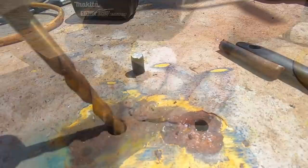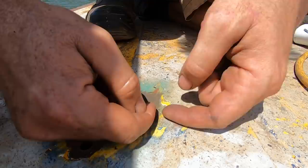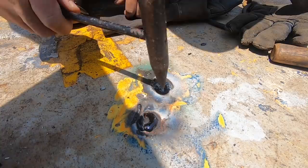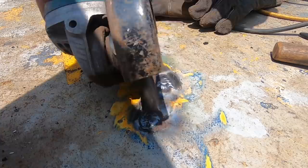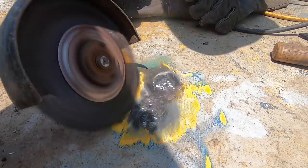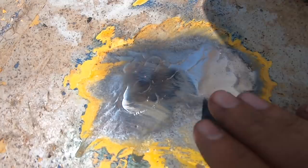What I'm doing is actually drilling with a 10mm drill bit, then with a bit of an interference fit, cut it in. Then I'm going to weld around it and grind it off. Once they were welded up, I just ground them flat — it's getting sandblasted so I'm not worried about the grinding being too smooth or anything.